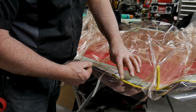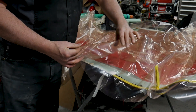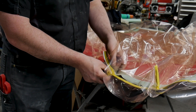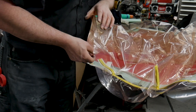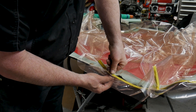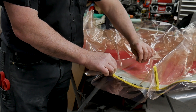One more time, back on the flat. I'm carefully pressing down the bag material into the tacky tape on the perimeter of the mold. This is the way that you get it leak-free right at the start — you can't miss a single detail. Watch here as we insert the pleat — the pleat just folded back on itself a little bit. This is the way I do it if I've got a straight run: if the mold and the bag just need to lose the perimeter difference and it's straight, I just fold the bag, get it straight, and carefully apply it, pressing it right back down onto that mold surface. That ensures the bag will fold up and stay square.